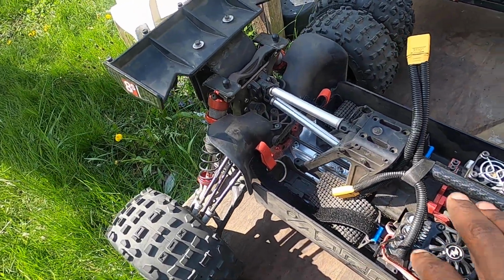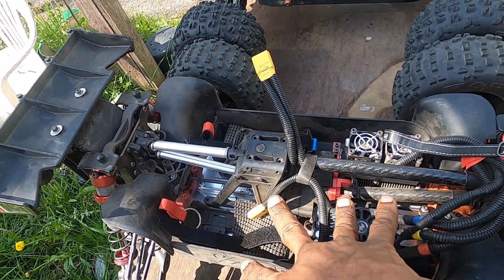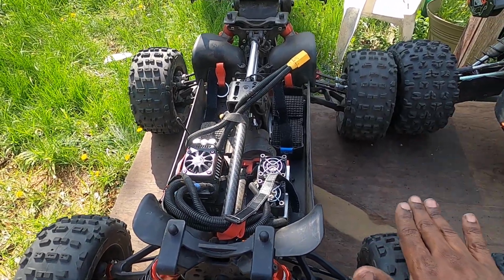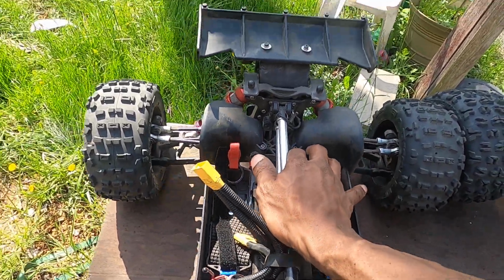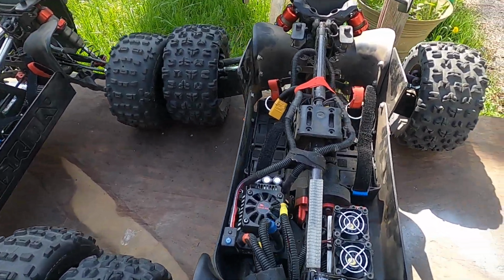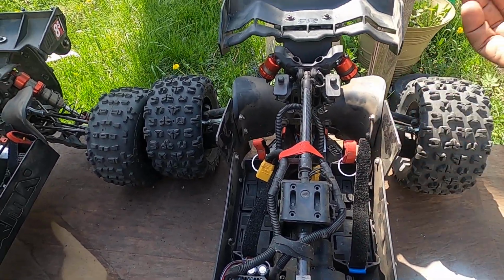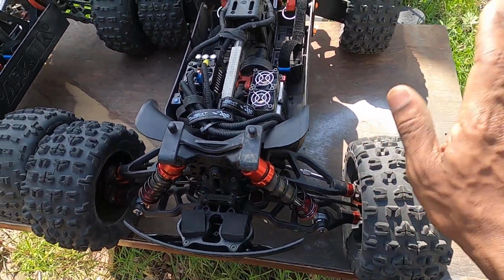The Crusher has both front and rear CVDs the same length, 148. So that makes this truck pretty much dead solid, perfect balance front to rear, a lot more control in this thing. Mainly because, yeah, this is a Kraton. So the rear dog bone is so much longer than the front dog bone. So you're getting a shit ton of power to the front wheels.